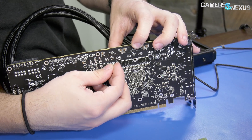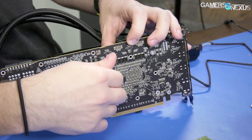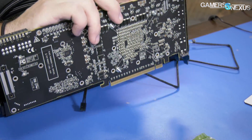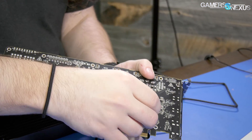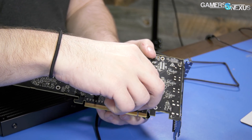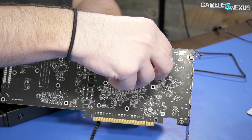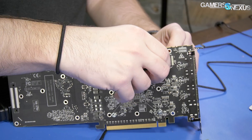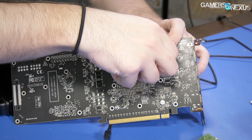We're going to be offsetting the power on this card to 240. I don't think it will actually do a full 240 offset, but it's basically going to max us out. Before, we were hitting a limit — either a current limit or a power limit — bumping into 300 watts and couldn't go higher. Buildzoid told me that as long as we keep the VRM under 100°C, which we can definitely do, and I'll put thermocouples on there to be sure, we should be able to do at least 360 watts through this thing.